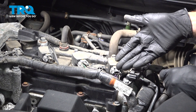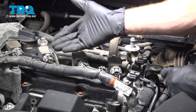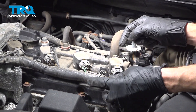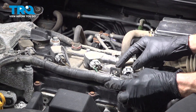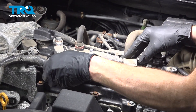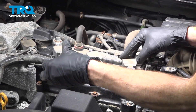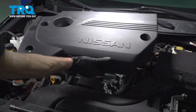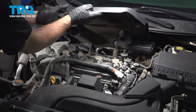That feels good. At this point, the process is the same for each and every one of your spark plugs. Once you've completed them, continue on to securing the wiring harness. Take it and align it with its mounting points along the top of the valve cover, then press it into position. Double check everything along the way. Let's get ready to install our engine cover.